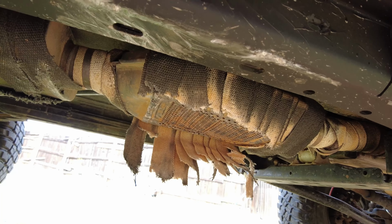Well, the carnage on the Jeep wasn't too bad, and I learned a lot on the trail, especially throwing it in neutral and revving the Jeep while turning so you don't have to do a 10-point turn in the middle of an obstacle to get the correct line was awesome to learn.